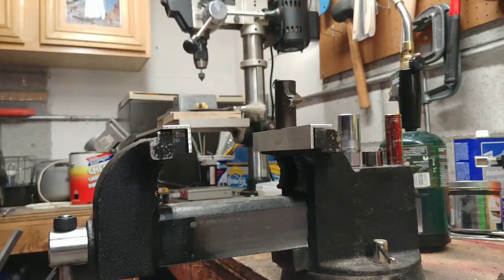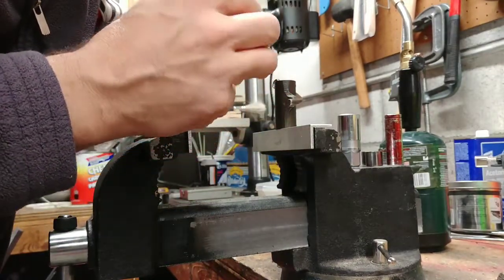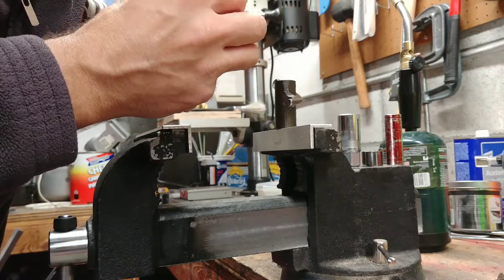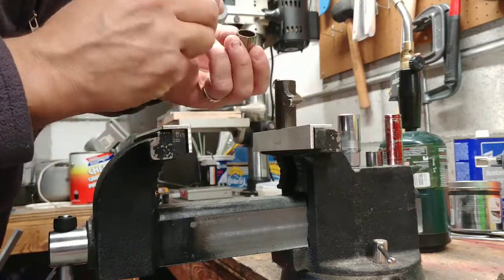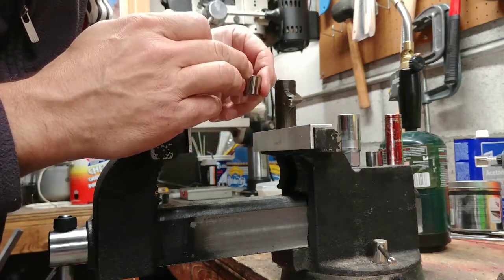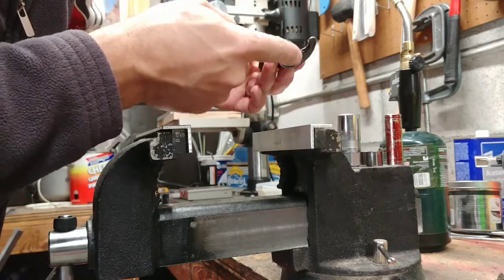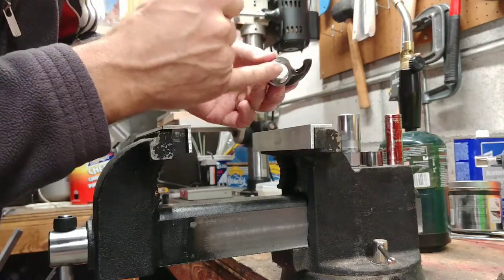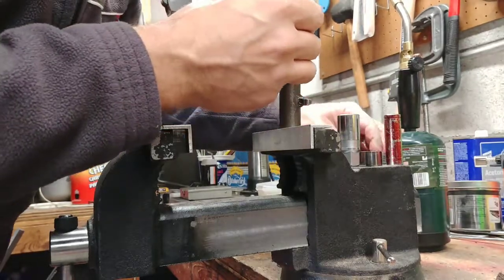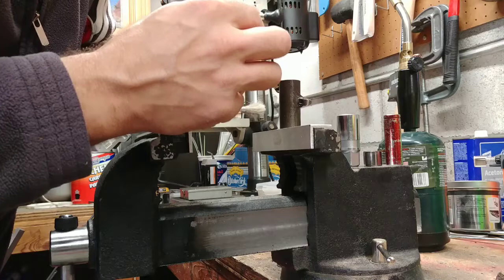And now we're just going to grab one of the new ones, and I will leave this foam piece in there. They look really a little chintzier. They're probably made in China. And the old bearings actually have one side with writing on it that's really flat, and the other side is a little rounded, and you would put the rounded side to the inside of the rocker. So the surface with the writing on it is outside. Here in this case, both ends kind of look the same.